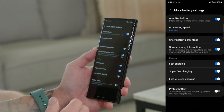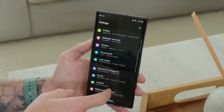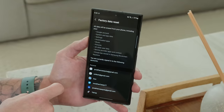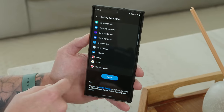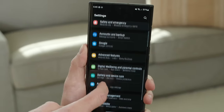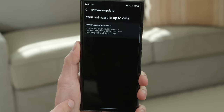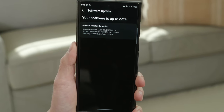If you've been using your phone and notice Adaptive Battery was toggled off, turn it on and monitor whether battery improves. If it doesn't, you can perform a factory reset and toggle it on once the phone is reset. Factory resetting can also fix bugs from third-party apps, One UI, or Android itself that might be causing battery drain. Additionally, make sure your software is up to date — go into Settings and under Software, check for available updates, since updates often fix battery-related bugs.